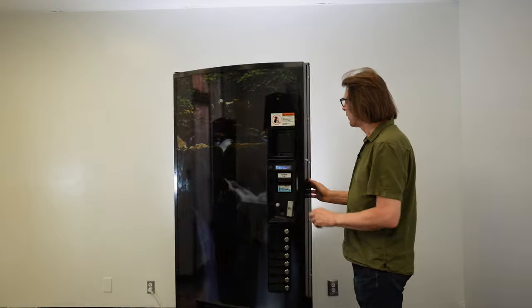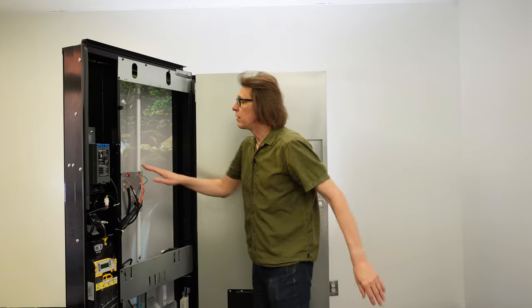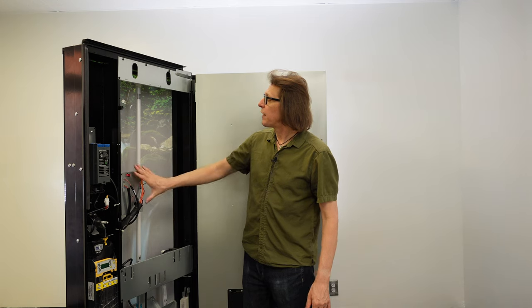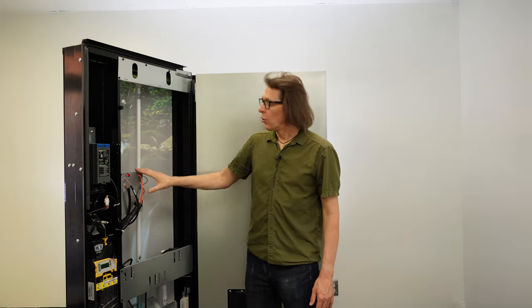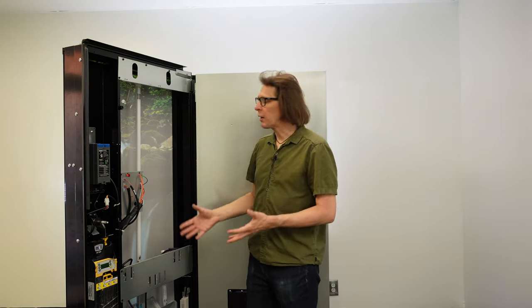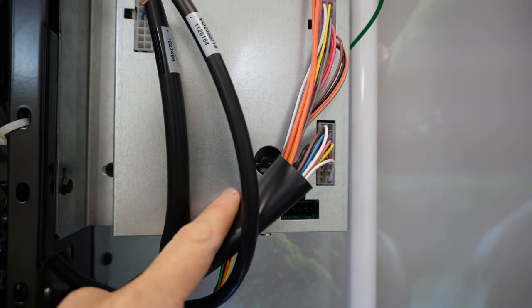The first thing we need to do to price the machine is place it into service mode, and that is done by pressing the service mode button. I'm going to open the door on the machine, separate the inner door from the main door, and locate the main control panel, which is found on the inside of the main door towards the center of the sign face. We're going to look for a circular hole that has a mode button inside that we reach in and press. If this is your first time looking for this, it may be hard because you may have to pull some harnesses out of the way to find that circular hole.